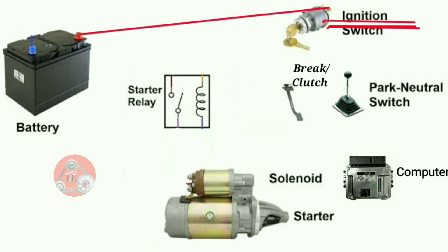After that we will have another wire — it can either be green or blue, let's say green. Another green wire runs from the ignition key to the clutch, and this same wire runs from the clutch or brake to the neutral park switch. Imagine as if you are seated in your car — you always have this clutch down, then the key, and then the park neutral switch.